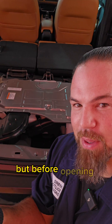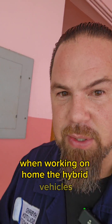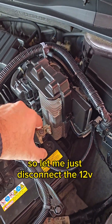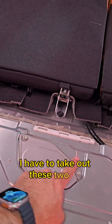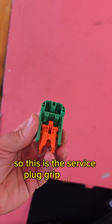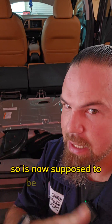I've got to open the battery. But before opening the battery, we have to disable the high-voltage system. Rule number one when working on Honda hybrid vehicles is that the first thing you do is unplug — disconnect the 12-volt battery. Second step, I have to take out these two 10-millimeter bolts to access the service plug grip. This is the service plug grip of the Honda — with this removed, I have completely disabled and opened the circuit of the high-voltage battery, so it's now safe to work.